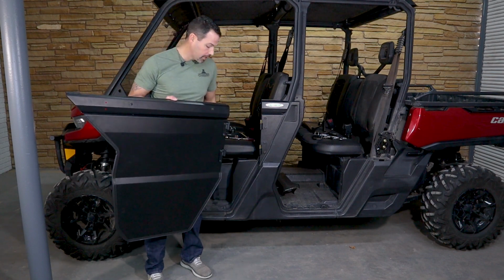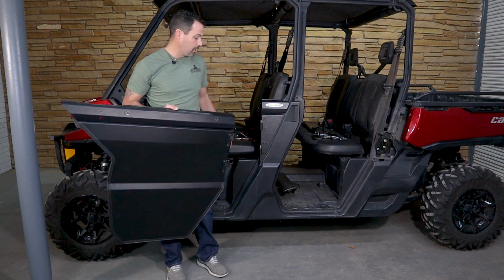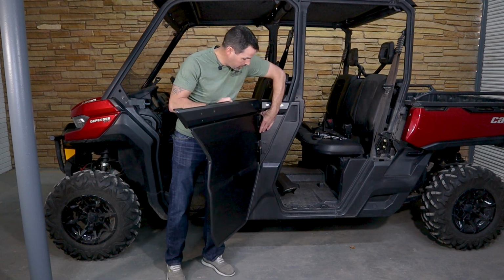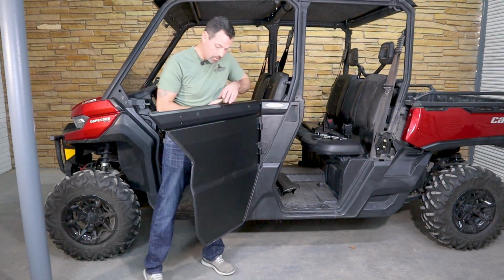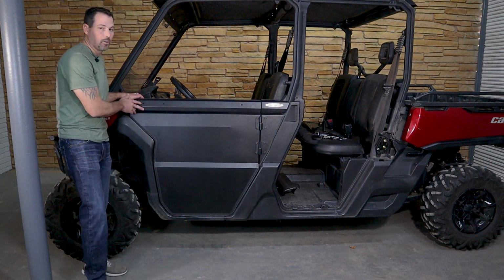But right now, we're going to install this door. And we have these female bullet hinges here at the back. We're going to marry those to the male. We've left both sets, the male and the female, loose, and you just slide those down on here. Sometimes they need to be pulled together, but now you have a hinging door. We'll be back in just a second, and I'm going to show you how to put on that latch and latch guard.